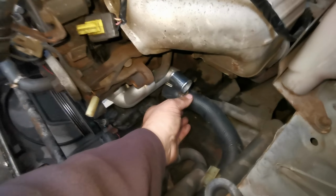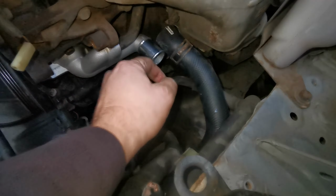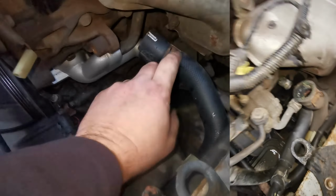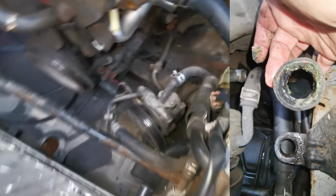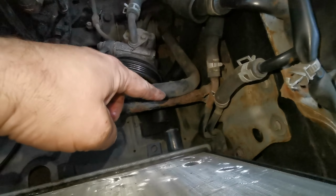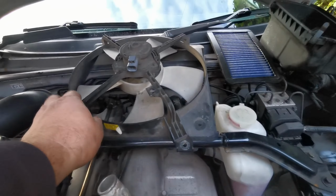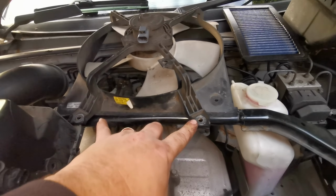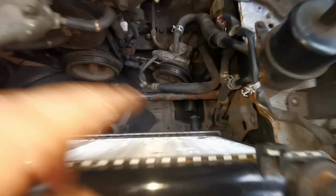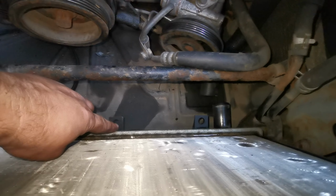Couple of other things that I did is, once this bottom radiator hose is off, because that goes on there, once I took the old one off I realised how manky it was. So with that already off one side, it literally follows all the way back to the bottom of the radiator here. You have to take the fan off. Once you take the fan off, that's literally just one clip there and 2 12mm nuts at the top, and then it just locates in these little things at the bottom there, so you don't need to do that from underneath the car.